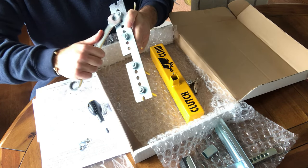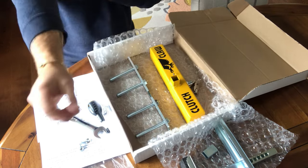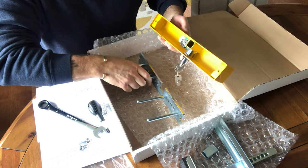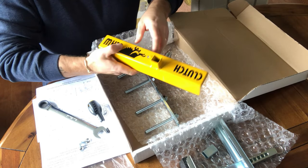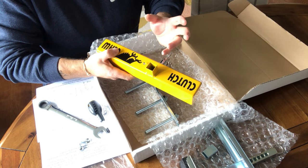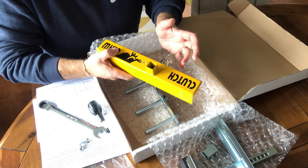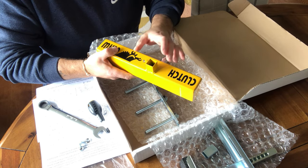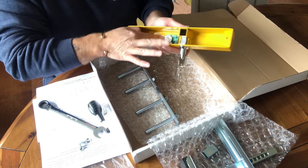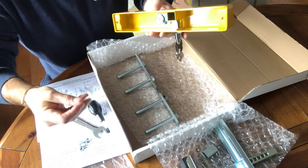They're all tight and nicely done up. Now we're going to put that plate back on and screw it back in with the screwdriver. But before you do that, underneath here you've got a light that flashes when this is locked into position — so it'll illuminate from outside. If anyone's looking in during the evening or night, that light's going to flash and they'll be aware there's some sort of security system in your vehicle. Before you put that plate back on, you need to pull this tab out, which activates the battery.